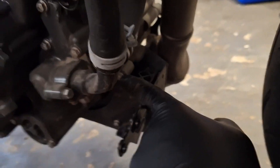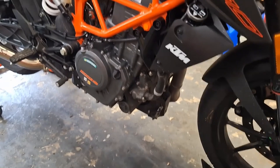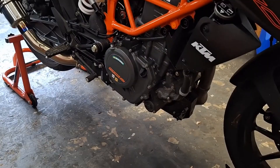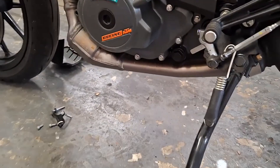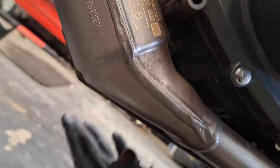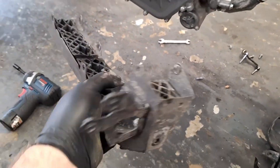Here's the right side of the bike. Starting from the front, there's another fastener right there. The right side ones are easier to get to — one right there and one right there. Take all six of those bolts off and remove the lower shield. I'm using an eight millimeter open end wrench to get that center one off. The others I zipped off with a quarter inch impact. I recommend getting a quarter inch extension along with it to help. All six bolts are off.